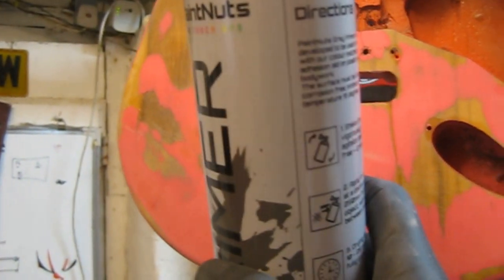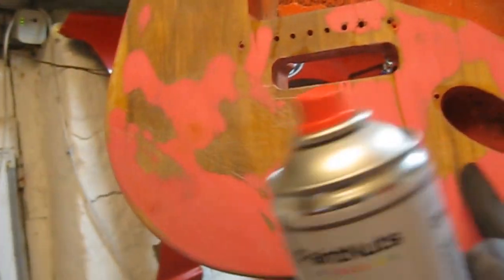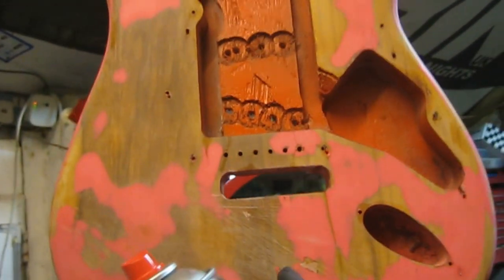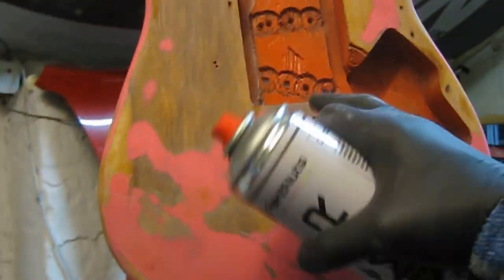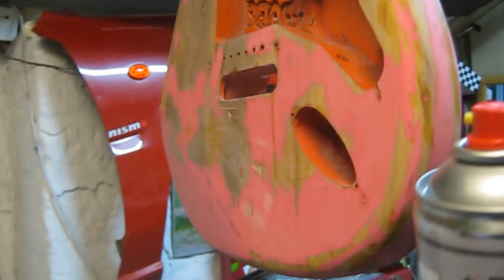These are quite stable, which I quite like. I use them on automotive stuff all the time. We haven't actually gone through the sealer here as well, which is really nice. We've got a really nice smooth finish. Yeah, there's some scarring in it, but like I said before, I'm not really too worried about that, because that'll help with the mechanical grip of the paint, with the amount of material we're going to be putting on it. So we're probably going to get about maybe 5 or 6 coats of clear on this in the end.